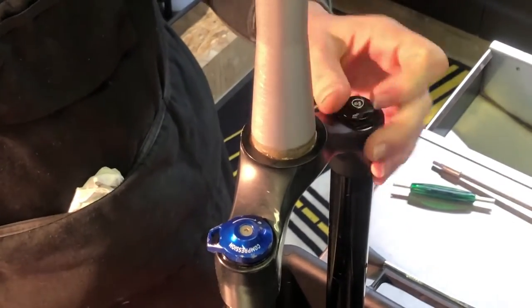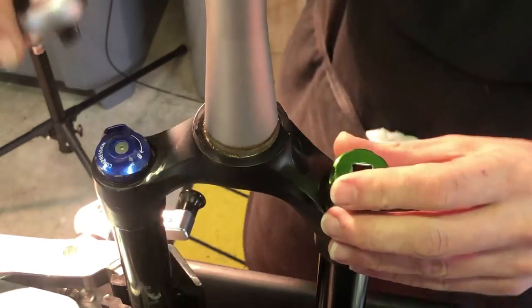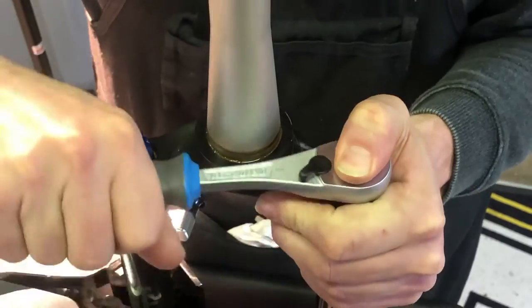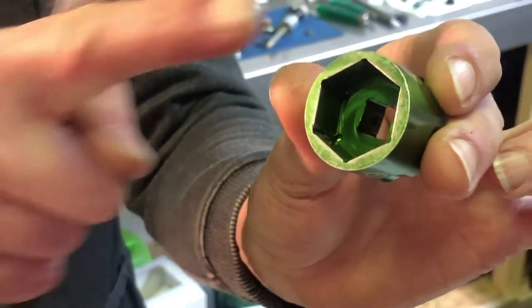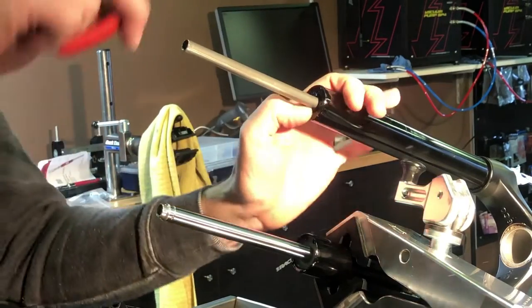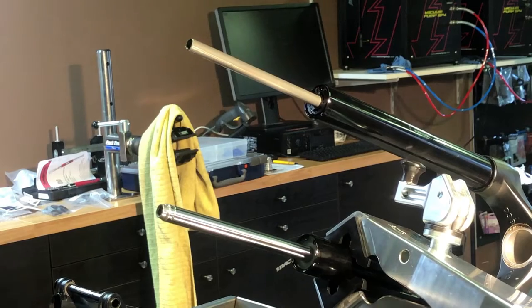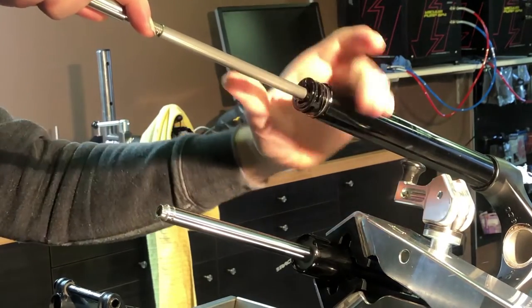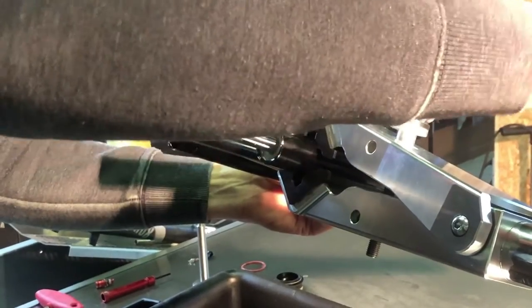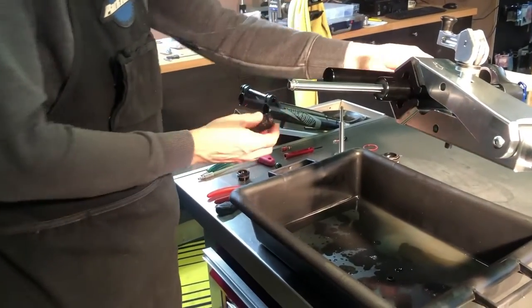Remove the air cap to get to the valve underneath. Make use of a valve remover tool to remove the valve. Remove the top cap using a 24mm top cap socket — don't use a standard socket, as a standard socket does not engage the top cap enough and may twist loose when pressure is applied, damaging it in the process. Rotate the fork so the stanchions point upwards. The air spring is kept in place with an internal retaining ring; using retaining ring pliers, you can remove this ring. Using the lower leg removal tool for some extra leverage, we can now simply pull the air spring out. Normally the air spring top cap is attached to one or more tokens — in this case the tokens had loosened and simply fell out of the bottom of the stanchion.